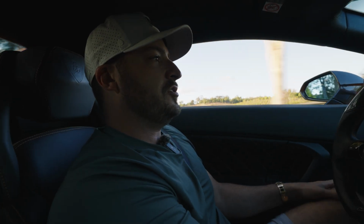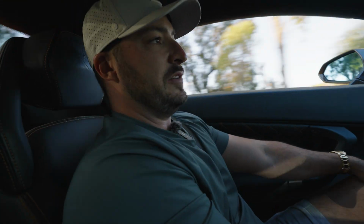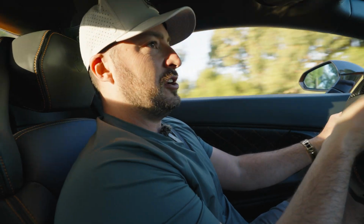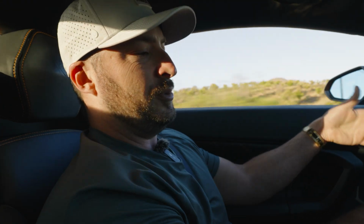I like to drive this car similar to how I drive a manual car. I have a 997 manual turbo, and when you're sitting at a light or whatever, you're in neutral. The same goes for this. It'll stay in first gear as you slow down, but I'd rather just go into neutral. You pull both paddles, it's simple, and then you're not just eating your clutch away.